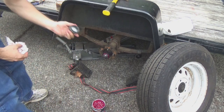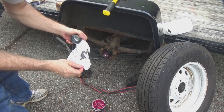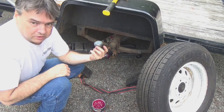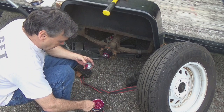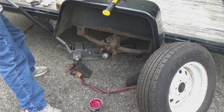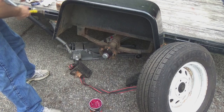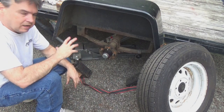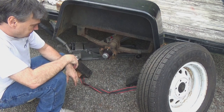Now we're ready to put the grease cap back on. Clean out the old grease — this is just black molly grease, not dirt. Throw a little dab of grease in there and then just tap the cap on. We're done — now I just have to put the wheel back on and torque the lug nuts down to 120 foot pounds, which is just like putting a tire on. That's pretty much all there is to repacking the wheel bearings on this trailer.